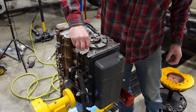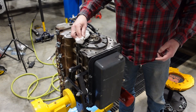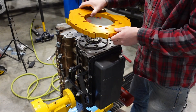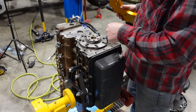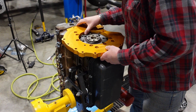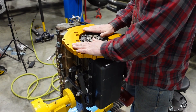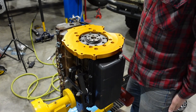Make sure your dowel pin is really nice and clean, and then make sure these contact points on the rear main seal are nice and clean. Take the adapter plate, make sure the back side of it is nice and clean. First we'll start it on the center portion, and then the dowel sits just a little bit lower so we can start that second. Just like that.